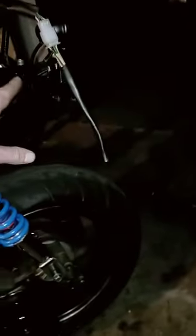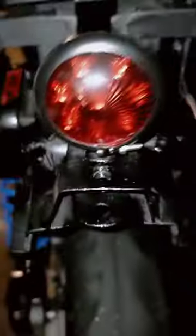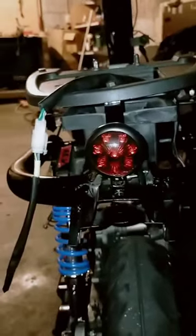Your brakes are specially switched in the negative. Your brake light will have 12 volts straight onto it, then one wire that goes to earth, and one that is a switched wire. If you do testing it will show as an earth, and that switched wire goes up to your handlebars and is the switch to turn the brake light on and off. Switching in the negative is very normal on 12 volt DC negative circuits.